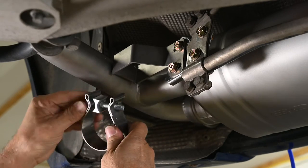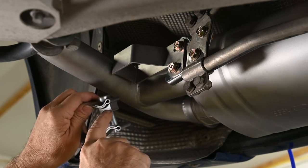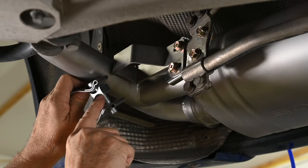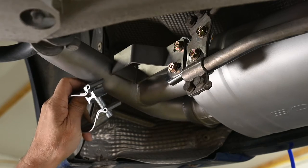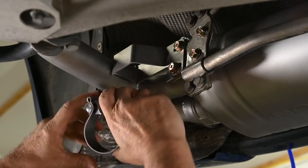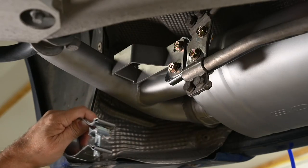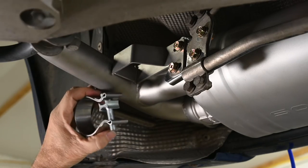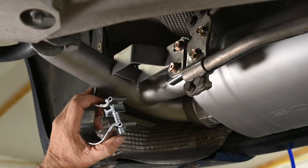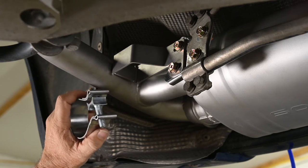this is a captive bolt. It's this little spacer piece here, the bolt is driven through it, and it's got little splines to hold it in place. So you can't just remove this bolt, fit it around, and put the bolt back in. What you gotta do is bend this thing open, fit it around, and then bend it closed again. I found it extremely difficult bending it closed enough to get the nut on it. So let me just do this one, and I'll show you how I finally figured out how to do this, and hopefully it works the second time.